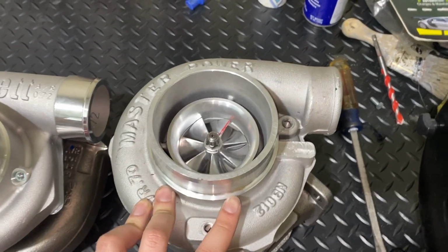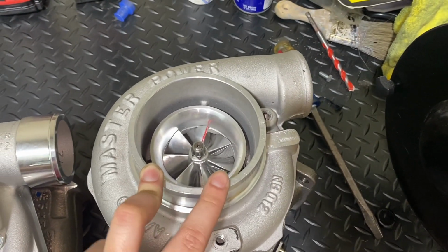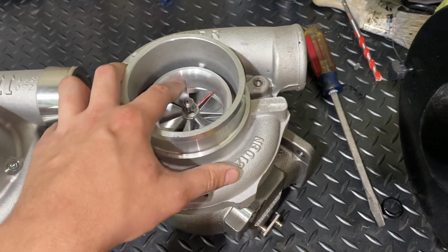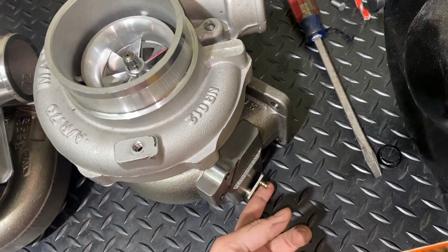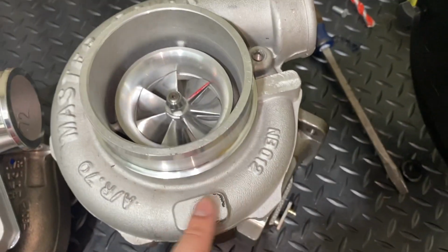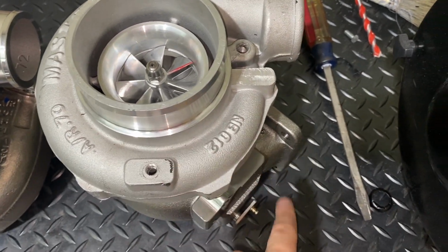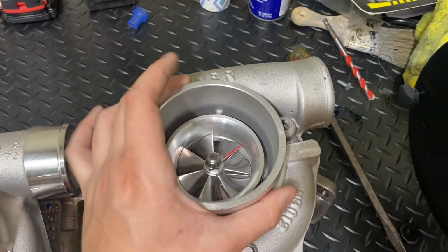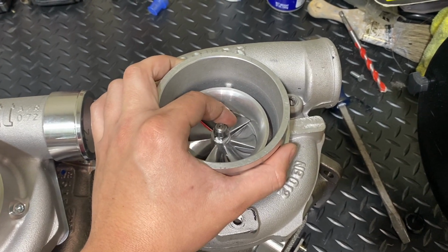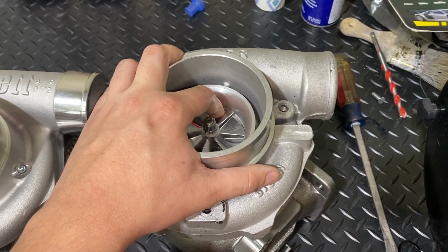So guys, this is the turbo my car used to have. It's a 61mm turbo, the NPR version, the first turbo we offered for the N55 turbo kits. So it's a 3.3 turbo. It has a factory wastegate actuator connection, so it uses the factory electronic wastegate. Here are the holes that bolt the bracket into it that holds the actuator. The turbo that came off my car ran 10.3 in the quarter mile at 136. With this turbo, the car made 620 horsepower on the dyno.